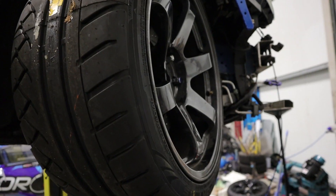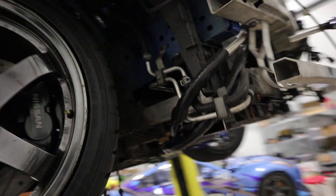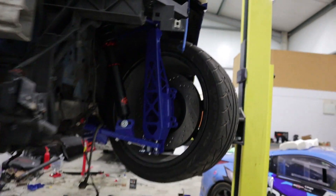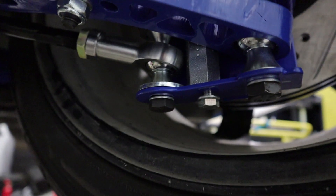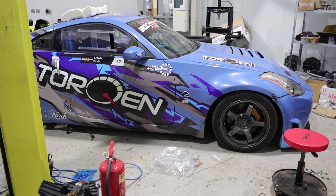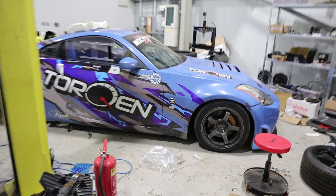I've raised it up some more — we are very, very raised now. I need to unscrew it all and check there's enough thread still in the base of the coilover because it's dangerous if it's too short. Now on the ground it does actually have just enough clearance in the arch to roll it around the workshop. This is full lock at the moment, and as you can see we get quite a bit of lock — it's kind of ridiculous. I don't know whether we'll actually be running that much lock because you can adjust the lock stops.